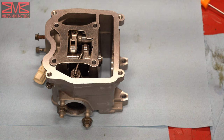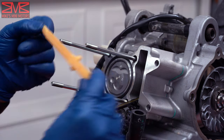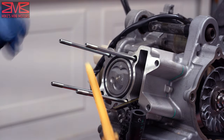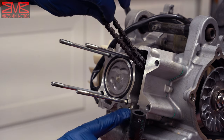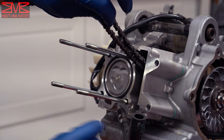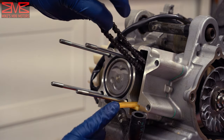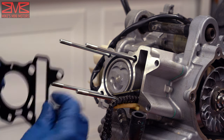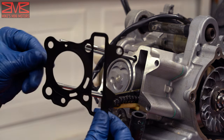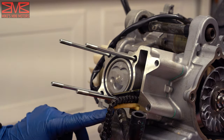We are now ready to put this thing on the engine. But before we can put the head on, we have to do two things. First, put the lower timing chain guide in — it goes on the bottom, there are two little indentations behind that tube, and this has to go in before the head gasket. Then the head gasket goes on. It's almost symmetrical so be careful — there's a little bump out here that matches the bottom of the cylinder.